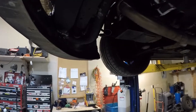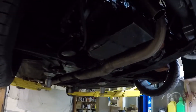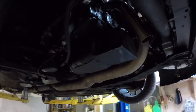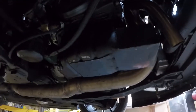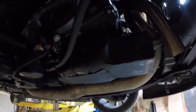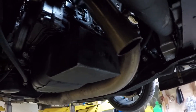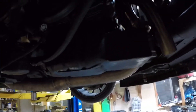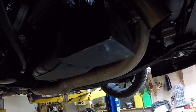Going down to my oil pan — this is one of the things that actually differs from Nate's car. Nate's car runs the actual Moroso pan. My oil pan is something that Nate has modified — we made it so there's extra capacity. I actually hold about another quart and a half of oil just because of this extra add-on we have right here.